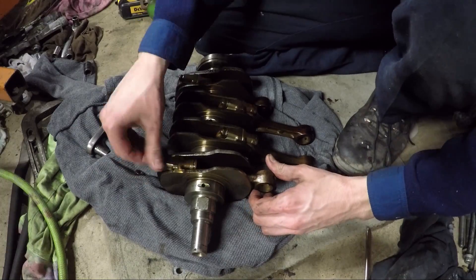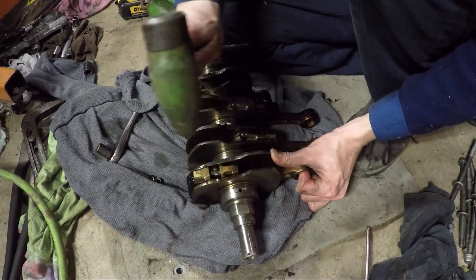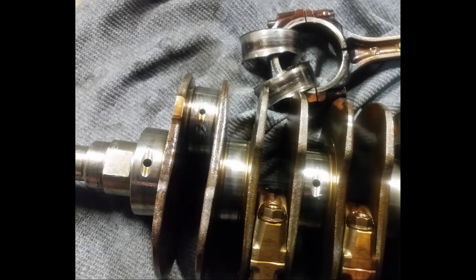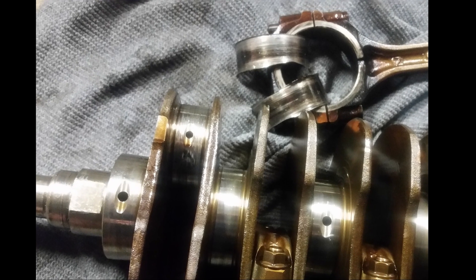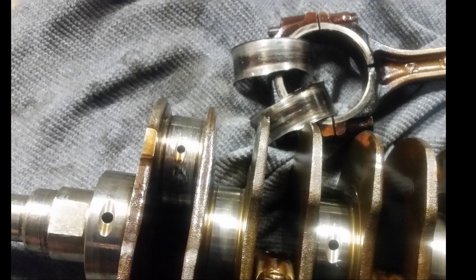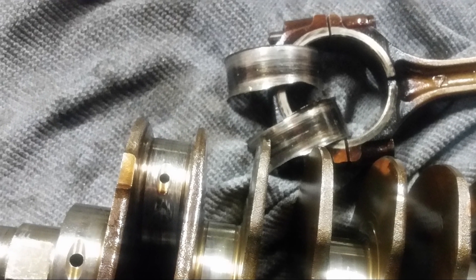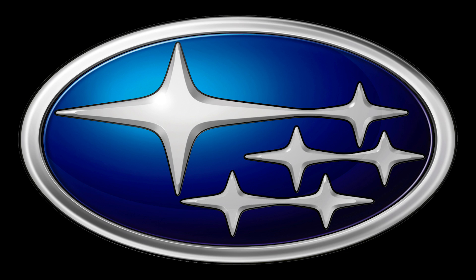I took off the rod but it was so warped I needed to use a hammer to get it off. And look at this bearing — no wonder there was foil in the oil pan. The bearings are all shaved and torn apart. That's going to be it for today, but next time I'm going to take some measurements to see how bad everything really is and talk to a few rebuild shops around town to get their opinion on getting this thing rebuilt. Thanks for watching and be sure to subscribe and watch my other videos.